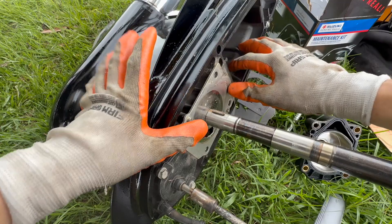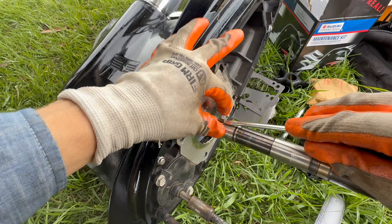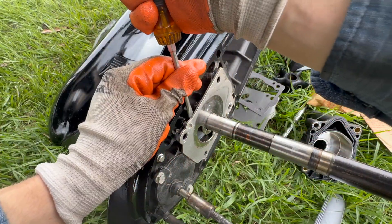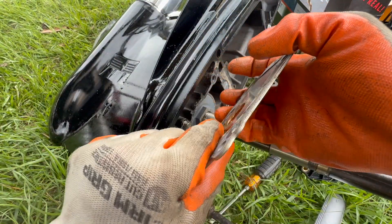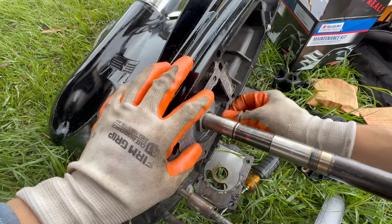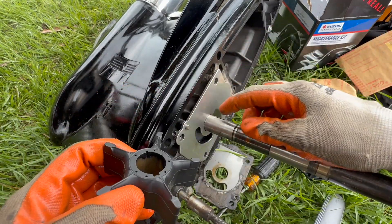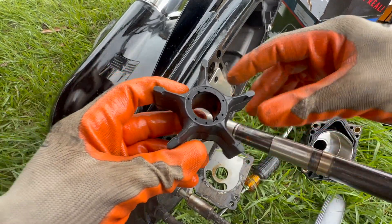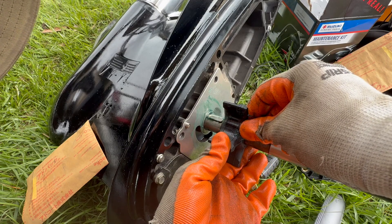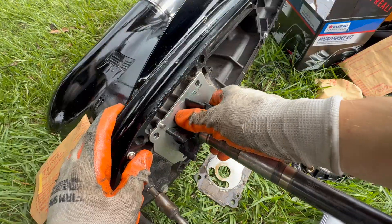If the lower unit is standing up, make sure the little key doesn't fall into any compartments. Take out the old key with a screwdriver and the plate will come off — gently pop it off. You can see the gaskets on the bottom. Install the new gasket, which has little stubs to help guide everything on straight, and then set the new plate on. Before putting the impeller back on, put a little grease around here and grease the shaft, then install the new keyway — make sure it stays down and doesn't keep popping up. Now the impeller is on.